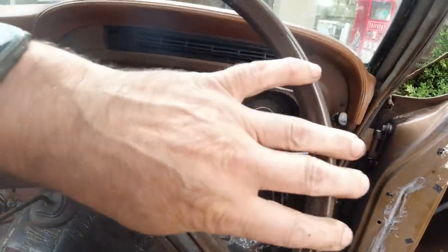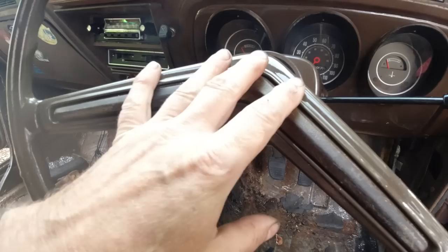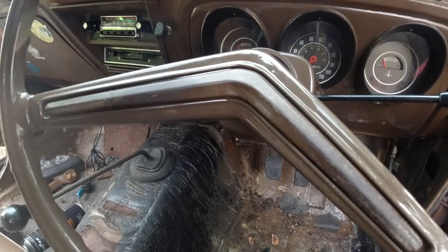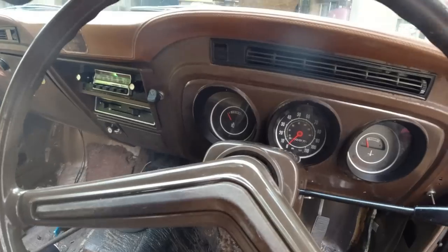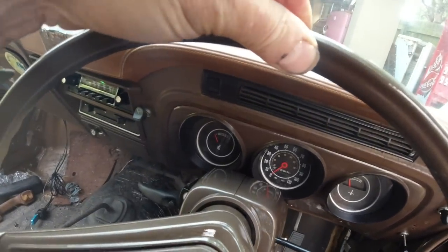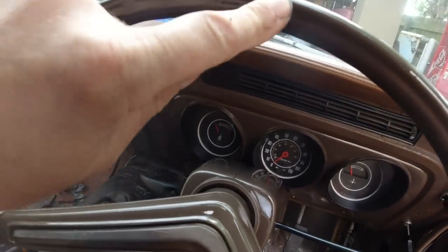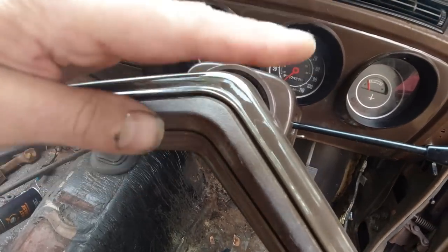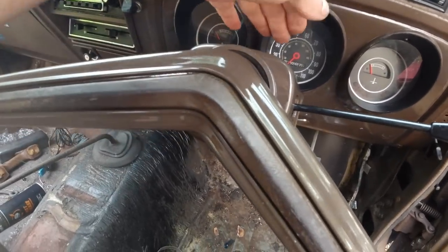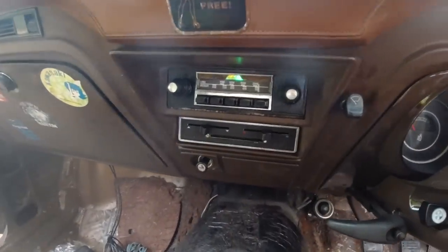The nice new wheel's on, the centre controls are on there. I think there's a bearing gone in the steering column because it's all tightened up and I'm getting movement here. There's a bearing at the top but I think it might be the bottom bushing coming out of the bulkhead - I'd better check that.